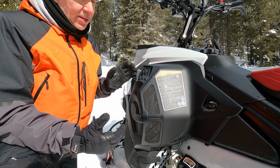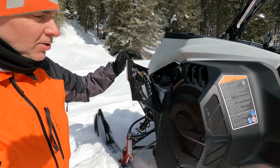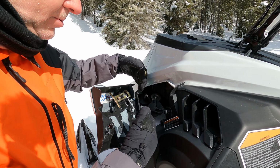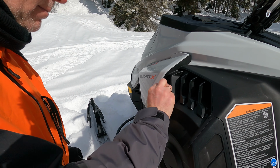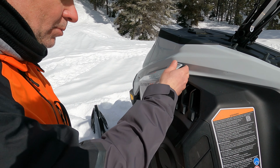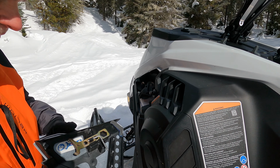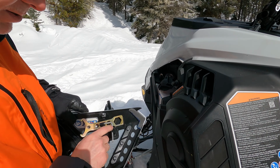So how? If I may, you see we do everything on that vehicle. Even the oil tank has been retooled, so we have the same oil volume as before, but the shape has been redesigned to be closer to the engine, and you can access it by this little cover here, just by one snap. So you open, you put your oil, you close. If you want to look at your pulley or belt, you open this one. You don't have to remove it, but for the clarity of the video, we will remove it. You have it in your hand, and the tool is here. We will need that tool later to collect the spare belt.